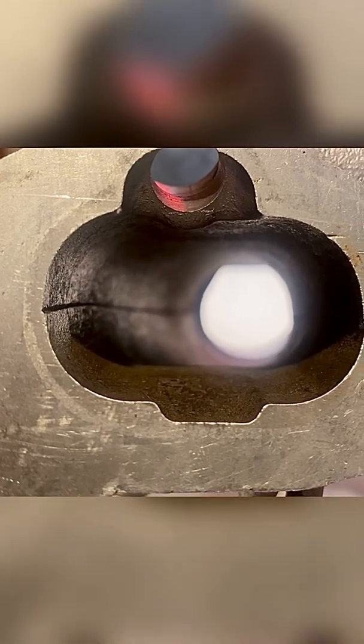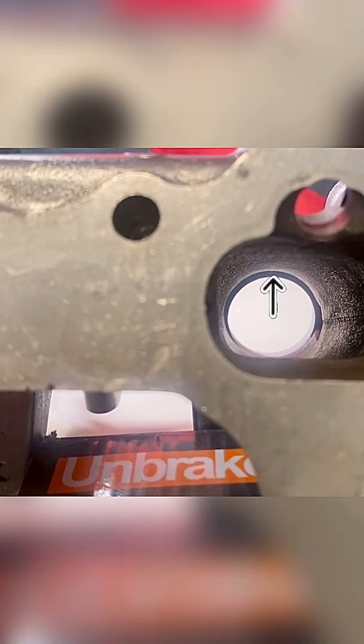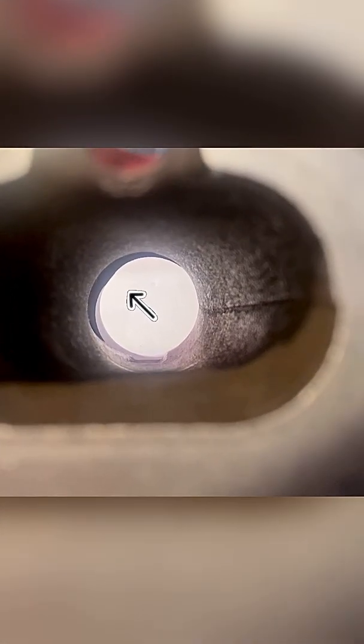When you look down you'll see a half-moon shape on some of them, either towards the top left or the right. That protrusion is the GE-to-GTE adapter flange — that's the part you're going to have to modify. It's not much, just port match it to the inner diameter of the GE runners. You're just going to knock that down and blend it in. Total time for this should take like 15 minutes — it's not too bad.